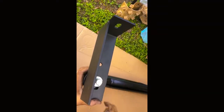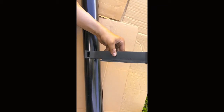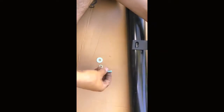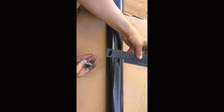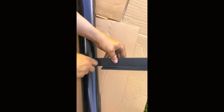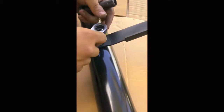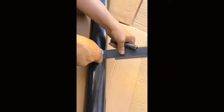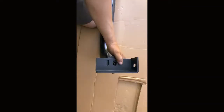Here's the middle bracket — same as before. You've got your lock nut, your washer, and your bolt. Stick those three together and put it through. I left them kind of loose — it's a 15mm socket you need. Keeping them loose gives you that wiggle play once you put them in so you can finalize the position you want.